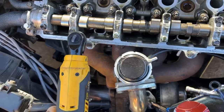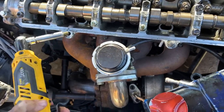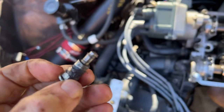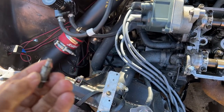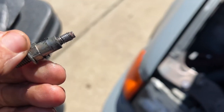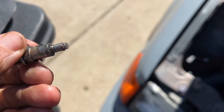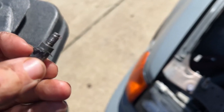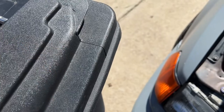These are coming out real quick and easy. Let me show you what I'm talking about when I say they're stripped. Can you see that right there? There is no thread. So how am I supposed to torque down the valve cover if there's no thread? Well, that's why we're going to fix it — we're going to get some thread on it.